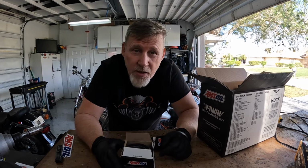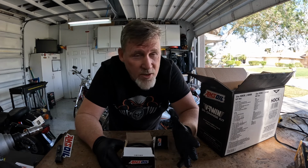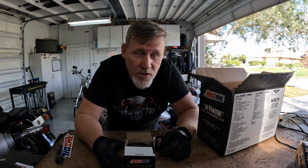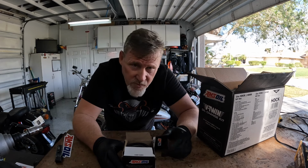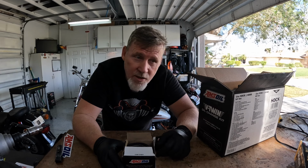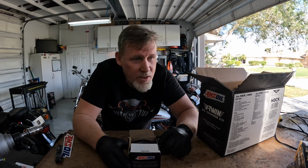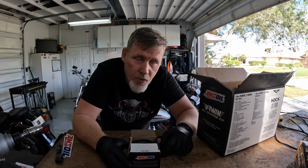Every 5,000 miles is what Harley recommends you change it. That is what I change it. Sometimes I go a little bit over that, but I never worry about it because AMSOIL is actually designed to go longer than 5,000 miles. So if I'm out on the road and I can't get an oil change right then, I'll just run it a little bit long. Anywho, hopefully this is drained enough now. We're going to change out this filter, put that drain plug back in, fill it up with oil, and call it good.